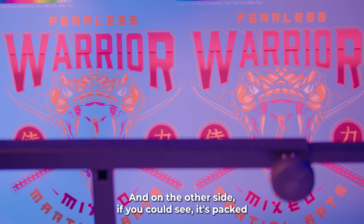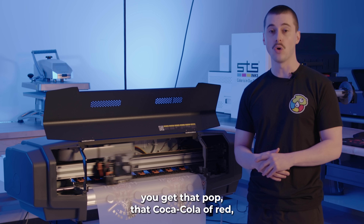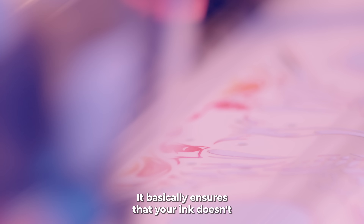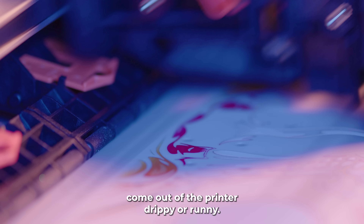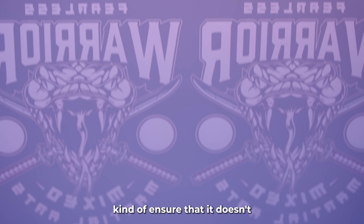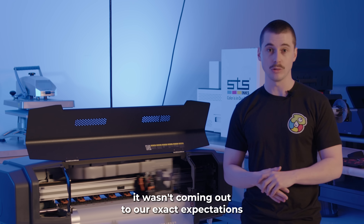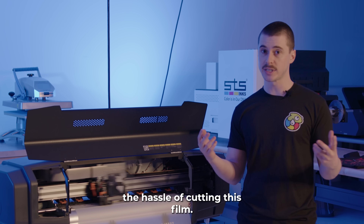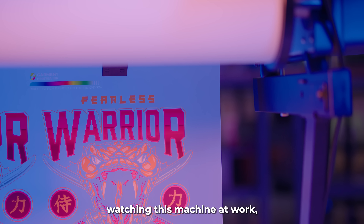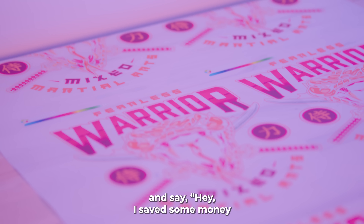On the other side, it's packed with those vibrant colors — really nice color gamut, really nice color matching. It just ensures you get that pop: that Coca-Cola red, that Pepsi blue, whatever it is you're looking for, this printer can deliver it. What's really nice is the heated platen, which ensures that your ink doesn't come out of the printer drippy or runny. In addition, that platen is also vacuum suction, so it keeps the film in place and ensures it doesn't pop up and strike the bottom of the print head. We could also abort this print at any time if it wasn't coming out to our exact expectations. And to save us the hassle of cutting this film, there's a built-in media cut feature in the software, so you can toss the scissors to the side. It's almost a treat watching this machine at work — you find that crisp design with beautiful colors and look to your wallet and say, hey, I saved some money in the meantime.